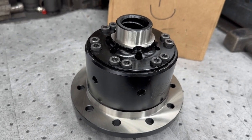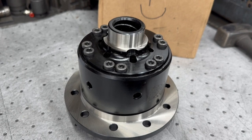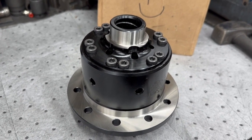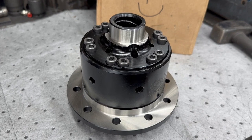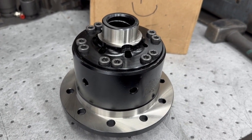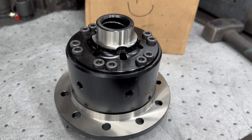However, another downside of an ATB is it's packed solid — there's no space inside. So if you chip a gear or break a shaft, it's highly likely you will blow it to bits, because there's nowhere for the bits to go and it will mash everything up. We can't tab-lock it, which I'll come back to later, because the whole unit is very hard metal. Last time we tried, we broke several cutters on a CNC machine.